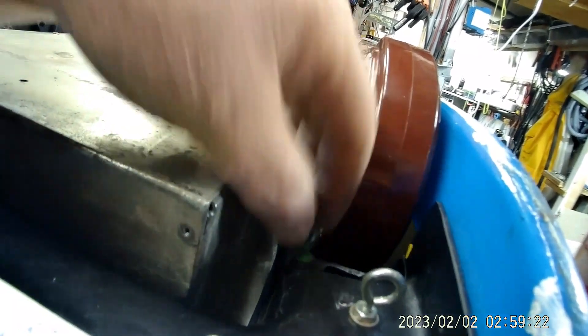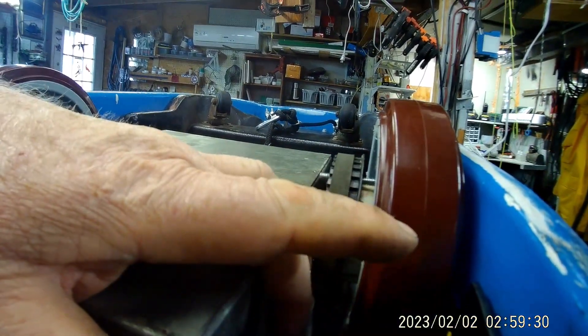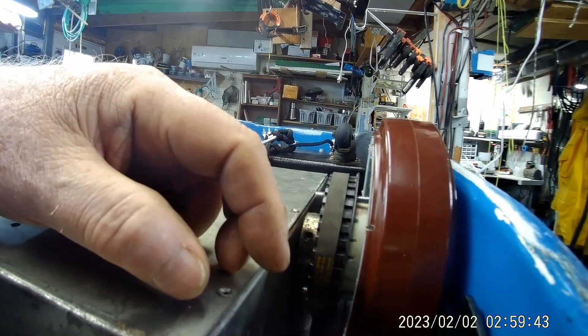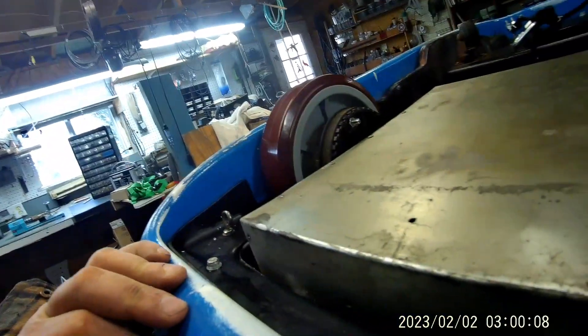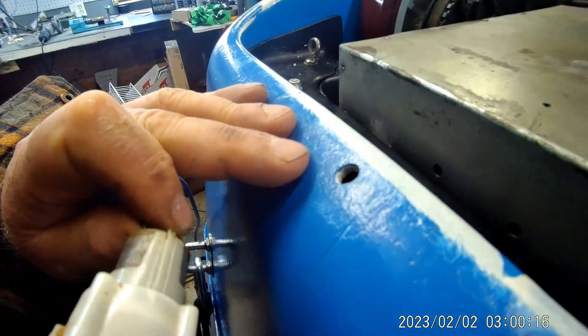This has got to come out. I know what it is - it's a drain. There's a bilge pump in here that drains out the bottom. However, it doesn't work because when I had gotten it, there was almost three gallons of water in this thing. That's why I drilled this little hole. I do have a pump that I started to wire up for it - here's a 12-volt pump that I wired up. I'm thinking about putting this on the inside and using this as the bilge pump. There's an in and an out. Put it back here, wherever the water happens to gather, and I'll bring the rubber tubing out of this hole just enough to where I can seal it off.